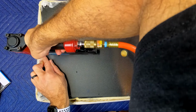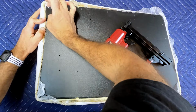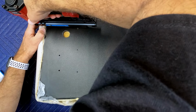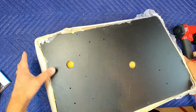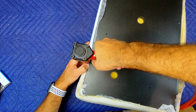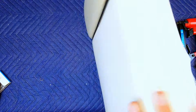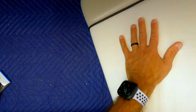You'll want to leave about a half inch to 3/4 inch depending on what was originally cut. The reason why you want to push down on the seat base is that when you release the pressure, it'll keep the vinyl tight. Start off by just putting in a couple staples around the edges, and then we'll go back and fill in the rest. Just going to check the other side once more to make sure there are no wrinkles.